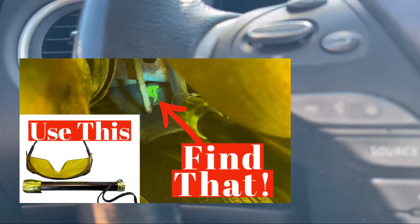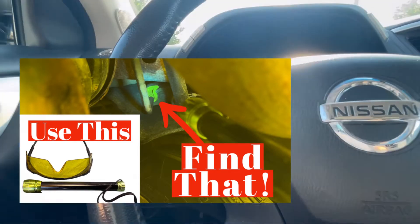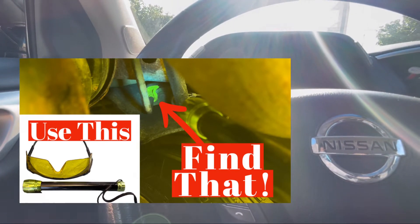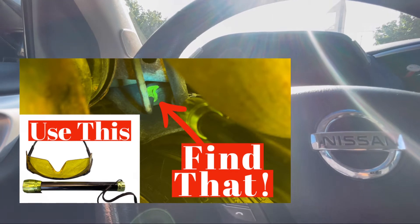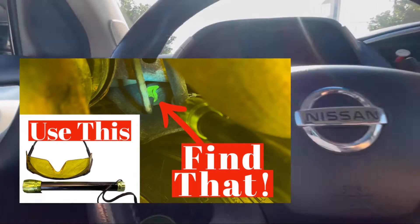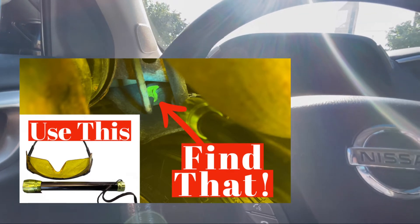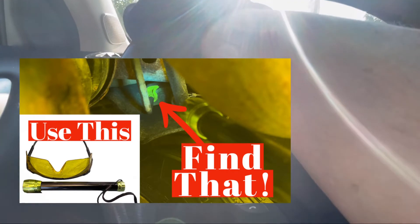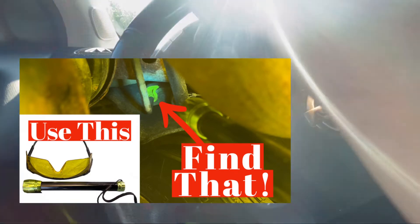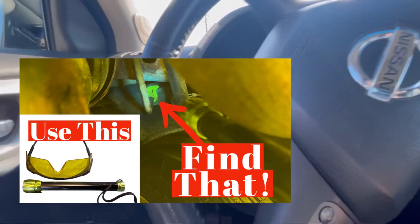So we're going to find out. First I'm going to recharge or recover how much Freon is in the system. Or I can take another approach — the quick one — detect the Freon leak with a UV light. So I think I'm going to do the UV light first, then do the recharge and see if it worked or not. That's how I approach this kind of situation.